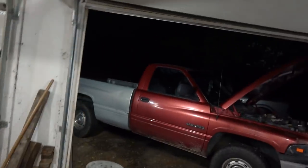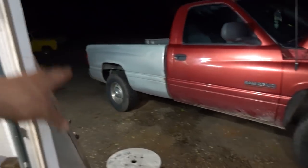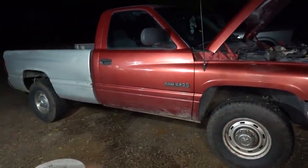Hopefully we get the batteries charged up overnight and I can come up with a quick solution. We're just trying to get this thing sorted out so we can actually do something with it. I still want to take the wheels off, check the front and rear brakes, and see what's going on before we start running this thing around. I'd really like to take it back and forth to work for that old-school vibe. Also — I've been ignoring the wait-to-start light because with common rails you don't have to wait, but on this older truck the grid heater was drawing the batteries down. That's another thing I've got to learn. Hope you guys enjoyed — please like, subscribe, and get out in your garage and get to wrenching!